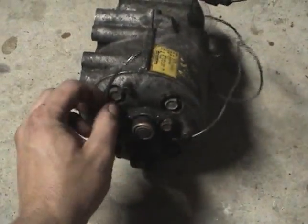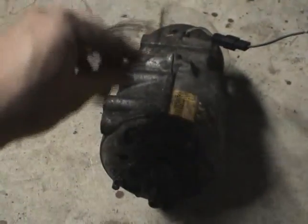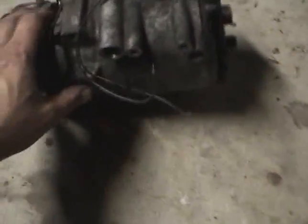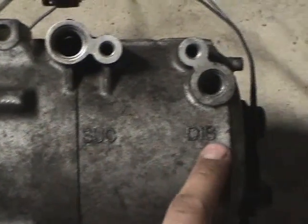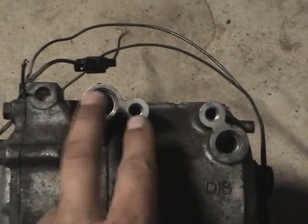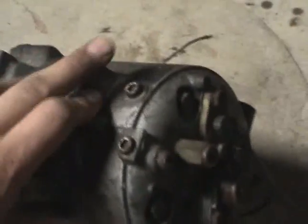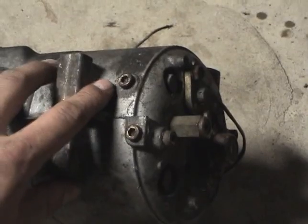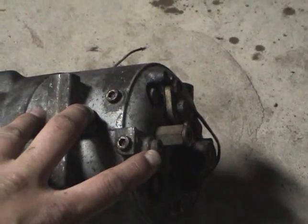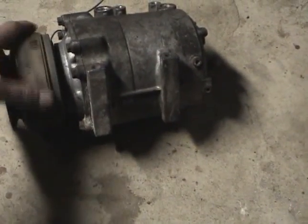Here you'll see the refrigerant temperature sensor with two wires. There's a specification in the manual for resistance that you should have for this sensor. Here are the two refrigerant lines — it says right on here SUC for suction and DIS for discharge. New O-rings go there and your lines bolt in. On the bottom there are three Allen plugs — I pulled these all out and drained a decent amount of old R-12 oil out of the compressor. You can also stick a blow gun in and blow it out to get any residual vapor out. These plugs have a copper crush ring under each of them. Clean that out the best you can and get all the oil out before you put in the new oil.